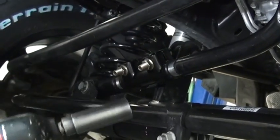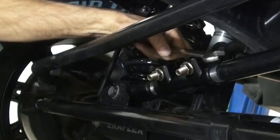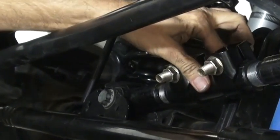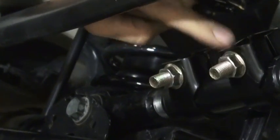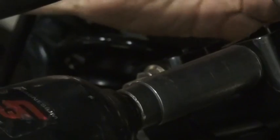One other thing. When you tighten these guys, they have got to be tight. This is a big piece of DOM with a little slit in it, because this sleeve needs to be strong so that we don't have any movement in it. But you've got to tighten these things, so just really crush them. Don't be afraid to get all over it.